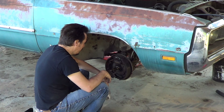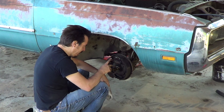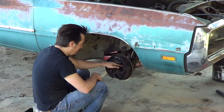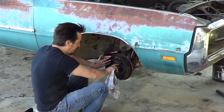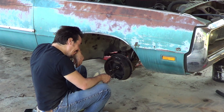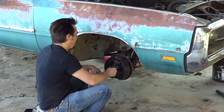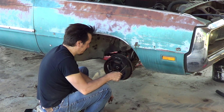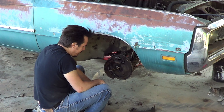Alright, I gotta do the front wheel now. It's a little different — it may be a little easier. There's no parking brake but the rest of it's the same: same springs, same adjuster. It just doesn't have the bar and the lever that wedges and twists to spread the bars when the cable is pulled. I already gave you my french fries, bro. You taxed me. Fry tax.